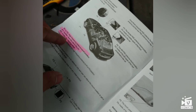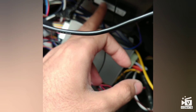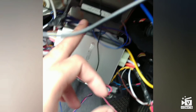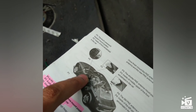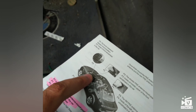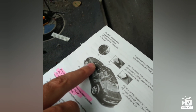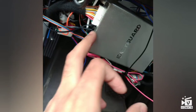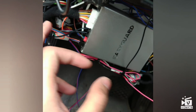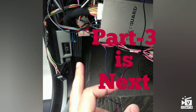The high-frequency antenna and two other ones are for the PKE system. The high-frequency antenna is right over here — it can be mounted under the steering column or around the driver's column area. I placed it over here because I already have the touchpad there. The red wire connects it. The two PKE antennas handle the range — when you come close to the car it unlocks, and when you walk away it locks. One has a long wire and one has a short wire.